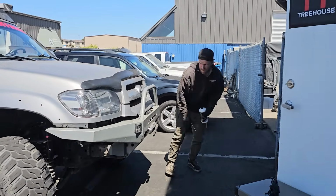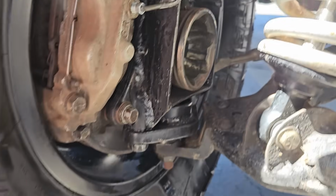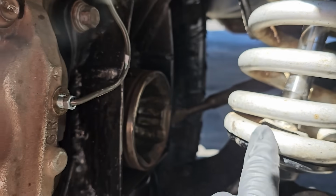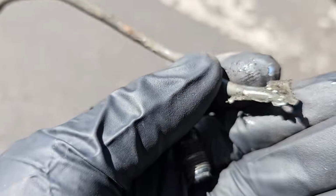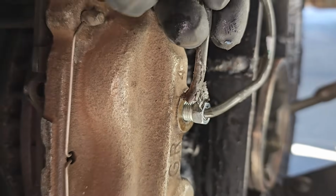Thank you, my friend. Oh yeah. So Michael just noticed that because on this spindle I don't have a steering stop anymore, my brake line was hitting my coilover. He was showing his girlfriend the spindle and he saw this, which is now right here, was just smashed to oblivion and leaking everywhere.